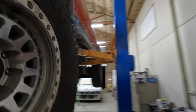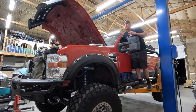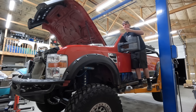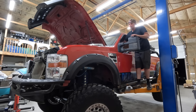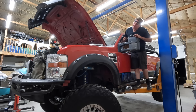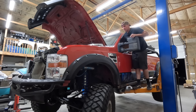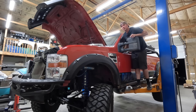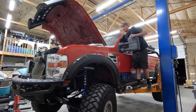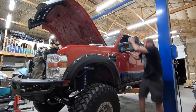Tomorrow morning this thing will be back together and we're going to go wheel it and figure out if all this steering worked or not. It has to work — it's been so much work. I am so tired of being covered in power steering fluid. I got the hoses made, they're in place, they go up to the box. It's a little chattery — you can see the wheel kind of chattering as it goes — but that just means it is making pressure and has a little bit of air in the system. I think we're good to go. Finally feels like it's supposed to.